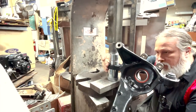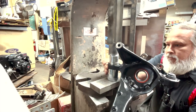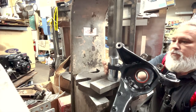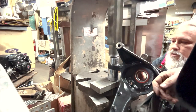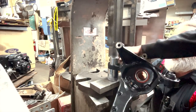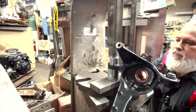Speaking of the right tool for the job — Brett eventually texted me back and let me know he'd just stepped out for lunch and I was free to head over to solve the bearing problem. We used his enormous compound arbor press and it made instant work of these things. The same job that had taken me close to two hours at my shop took maybe two minutes. I can't afford one of these, but it's a reminder to approach things the correct way — using a bolt to draw bearings in is unquestionably not the right method. Thank you, Brett, for saving my butt. We've got all four outer control arm bearings pressed into place.